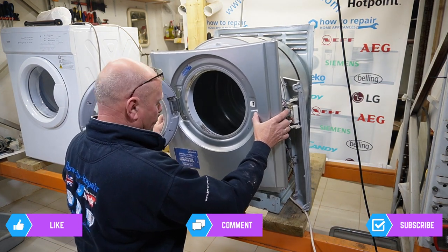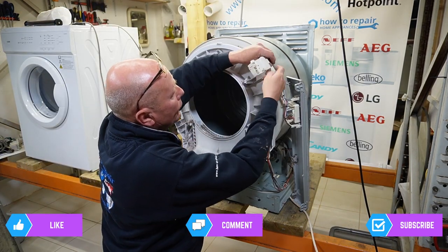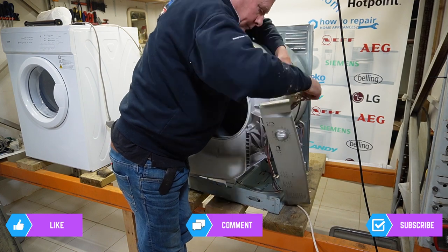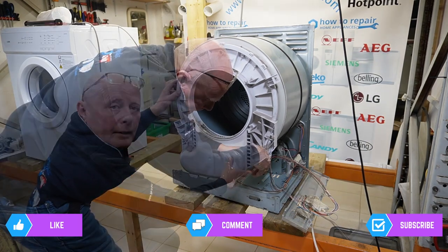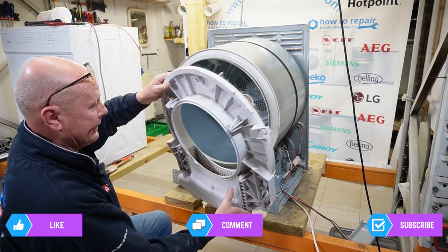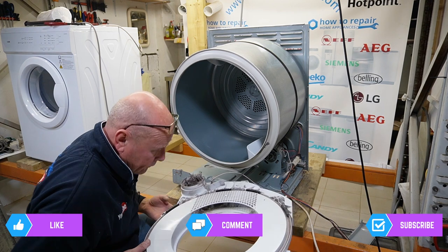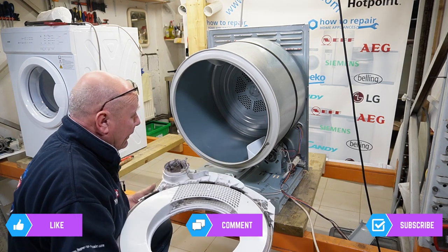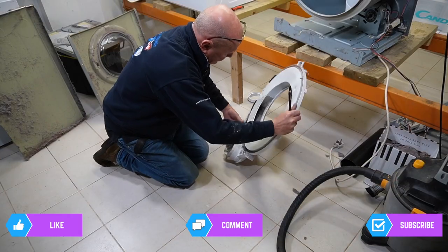The panel should come away, and we just need to release the door lock. I just need to remove the wiring off here and also remove the clip — it's just a cable tie. Now I can take the ducting system off, but it does support the drum, so do be careful. And here we have the ducting system. There is also a thermostat attached to the rear of the ducting, and you need to take the two wires off this. We have a load of supports, and they look all in good condition. Okay, we need to clean out this ducting system.